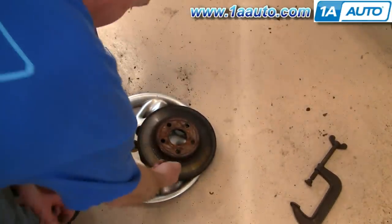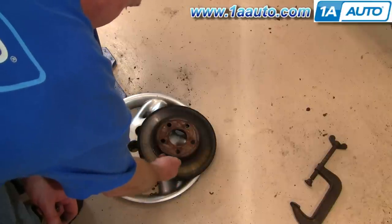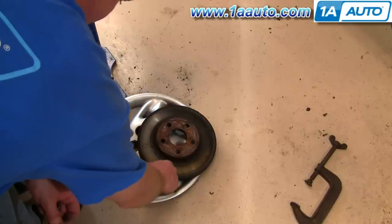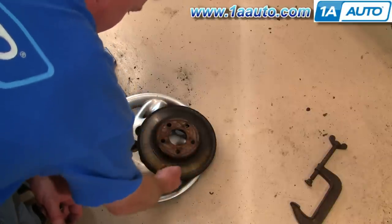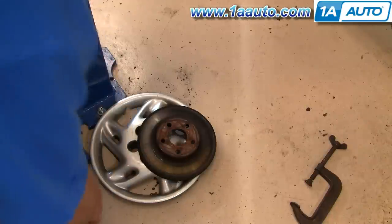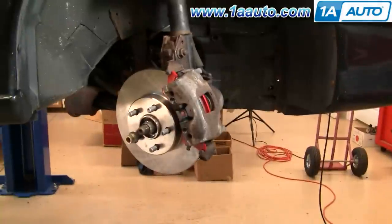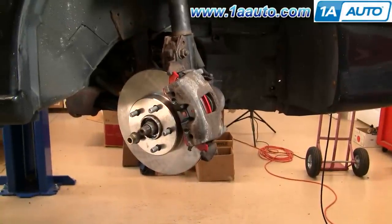Here's my original rotor from this car. If I run my fingernail on it, I'm not feeling any deep grooves. You want to feel for deep grooves around it — and I'm really not feeling anything, so this rotor is in good shape too. Actually, if I had checked these brakes the way they were, I would have left them alone and probably checked them again at another 10,000 miles. But for illustration purposes, that's what your new brakes will look like. You can put the wheel back on and go from there.